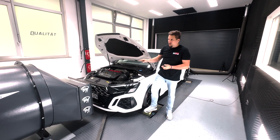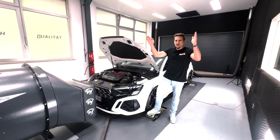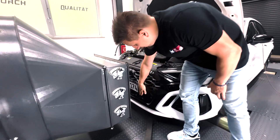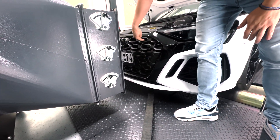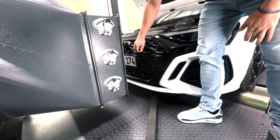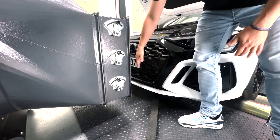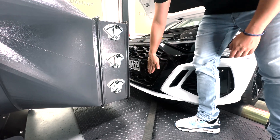This intercooler also has air guides around it, which we'll show in one of our next videos. On this model, air cannot reach the intercooler as directly as on previous models because the front bumper plate is closed. We only have inlets on the bottom and top, so the air guides are needed to direct air from the sides and top to the intercooler, since the main working surface is covered by the number plate and bumper.